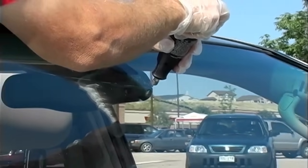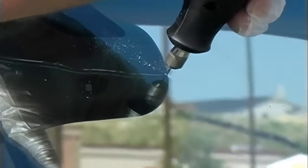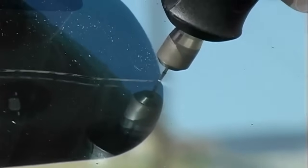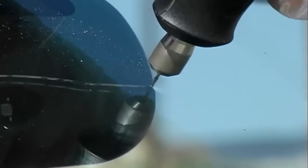I'm going to drill part way down and give it a little tap. You can drill on low or you can drill on high. If you have a new bit, the bit drills faster. With a little practice, you'll get a good feel for this drilling and tapping and stopping at the end of the crack.